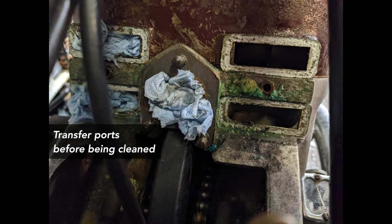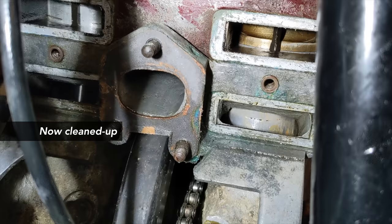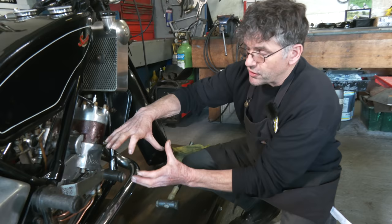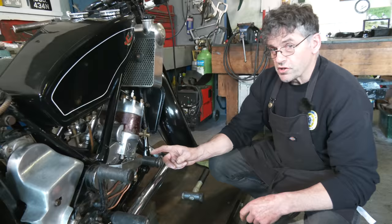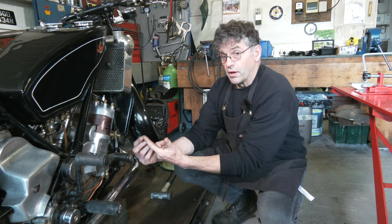Now there's something we need to do — we haven't done it yet. We've had the transfer ports off, we checked all inside there, and the drain down cocks have been checked, and the oil that was in the bottom drained off. On each side of this engine, this side with the pump has a window behind, like a round disc. On a certain rotation of the crankshaft, it exposes the oil hole. That delivers oil to the bearing, and also atomizes in the crankcase.